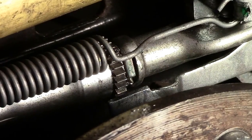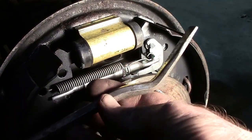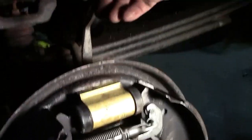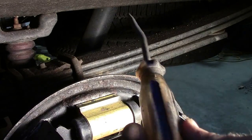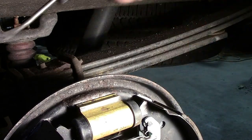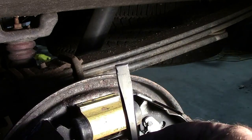There are a whole lot of tools you could use. One commonly sold tool is a brake shoe adjusting tool — it has different angles, is wide like a chisel on one end, with the other end not as sharp and having a cutout to reach in between things. The problem here is that on the back side we have a leaf spring bracket, so we're very limited on distance. Another option is old screwdrivers with the ends broken or ground and bent at an angle after warming with a torch. However, they're still too long or not wide enough. Since the brake tool is like a chisel, why not just use a small chisel from the toolbox as the cranking device.